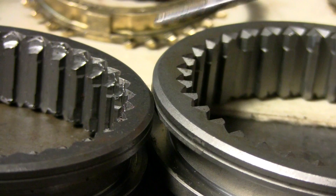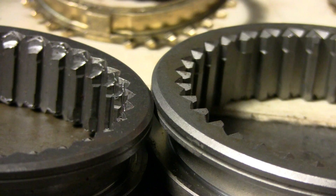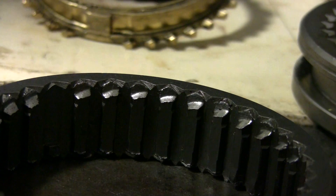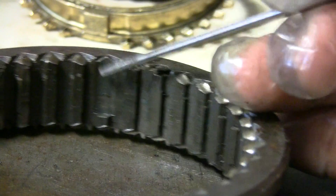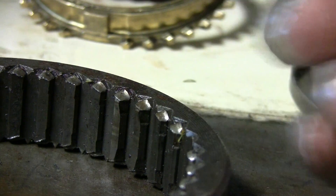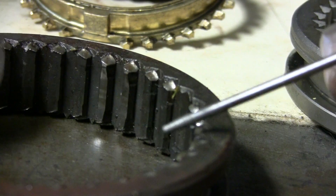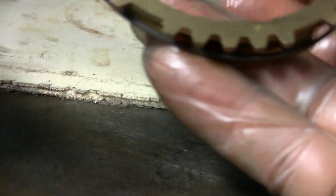This is a new one from Honda. Notice how deep the notches are on here — it's straight across, very sharp, very even. This other one's a little rough; it goes down too deep. If it doesn't go down too deep, it's still very repairable — kind of like this one. This one's repairable if I deburr the edges. It hasn't gone too far; you can still see it's even across all the way up top. So when looking at a transmission, I'd be kind of iffy on this one — the normal person probably couldn't fix it.